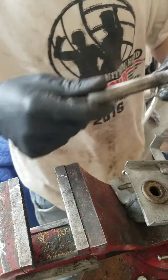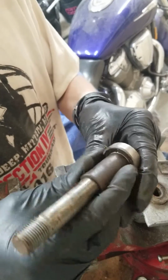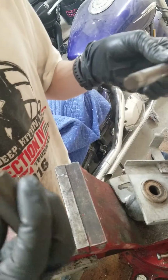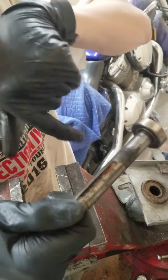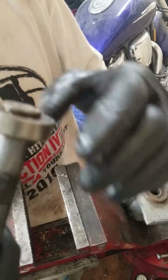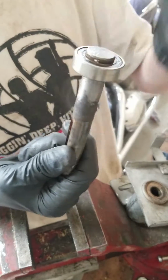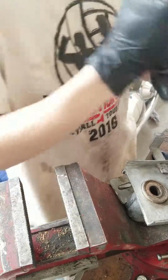So, I don't know if you guys can see what I see, but the reason that we couldn't take it through that other side is because we actually have this spacer in between, which is actually fairly rusted. You guys can see that. This keyway right here, that is really rusted too. This bearing is very bad. This bearing also has to be driven off on this side. That's why, because this is all buttoned out right here. So you can't force it through.